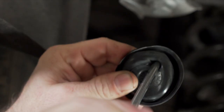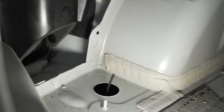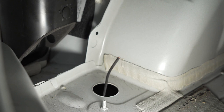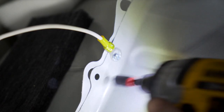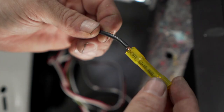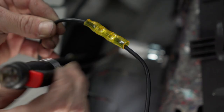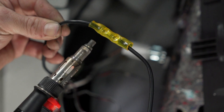Take your previously removed grommet and make a hole with a screwdriver so you can pass the wire from this side into the vehicle. Now insert it back in and pull the wire through. Affix a ground screw. You can now strip your two wire ends and affix the butt connector — we prefer to use a heat shrink butt connector, though it will not be included in the set. We can now shrink the plastic with our butane powered soldering iron and torch.